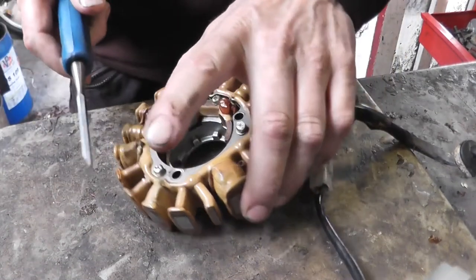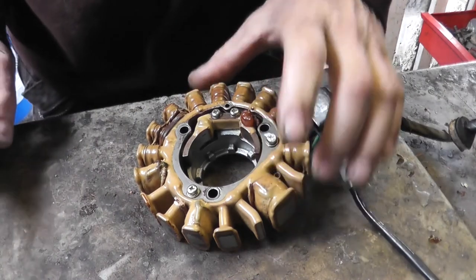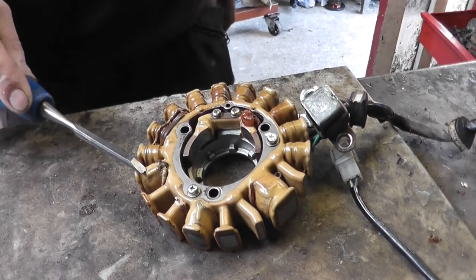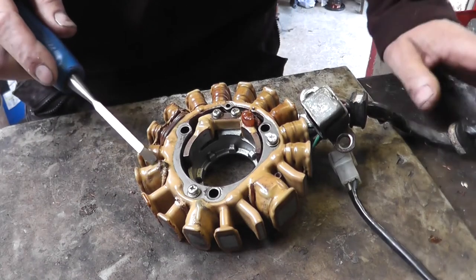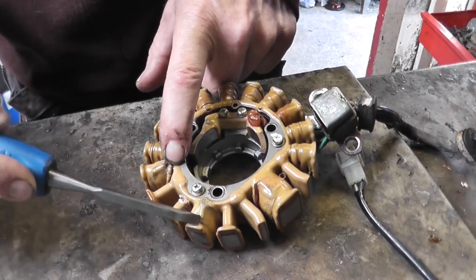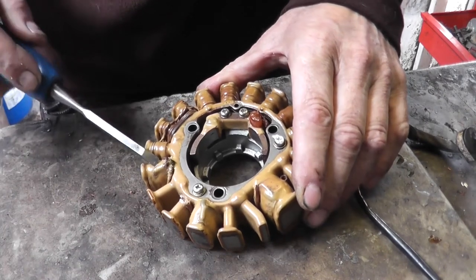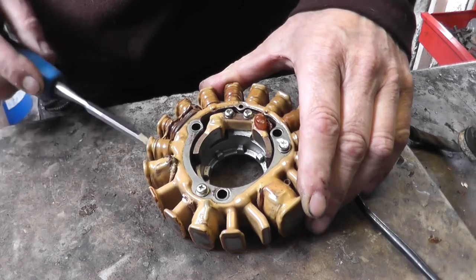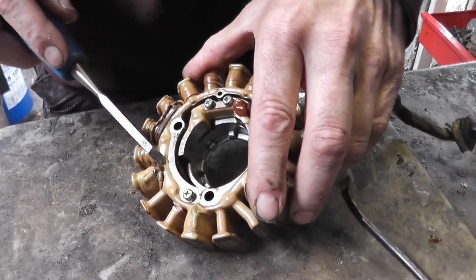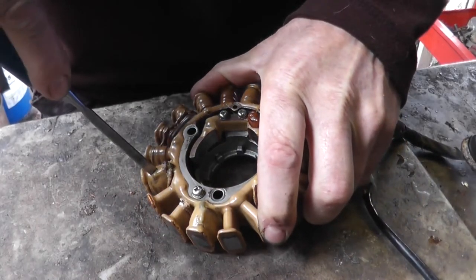All right, so we've come down to the workshop. We're going to start ripping this thing apart. As I said, you've got to be a bit brutal with these to get them apart. I'll get the windings off of that. Now, like I said, you've got three connections on this high speed source coil. This is where the white wire comes in initially — it joins up around here to that coil and that coil, but we've disconnected it around there back in the office. Here's the connection just here, so we've got to be careful not to damage this wire because that's the one that goes up to the white wire.